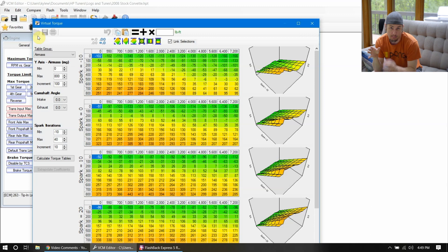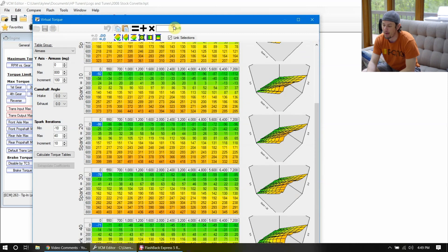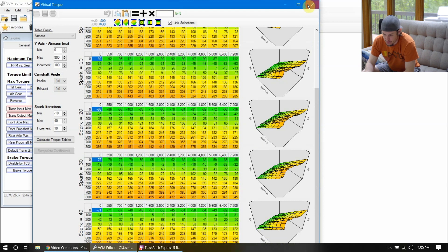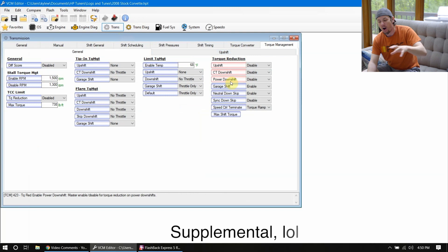If you have not updated these virtual torque tables, you're going to have issues. The cool thing is, if your virtual torque tables are set up properly, you technically don't really need to touch anything in torque management. So if you have this thing set up saying that whenever you're at 40 degrees advanced your peak torque is 650 foot-pounds, you can leave things — well, you'll need to bump the traction control one up — but you can leave things like your transmission torque reduction stuff enabled, and it's only going to reduce torque versus that 650 as opposed to the 450.